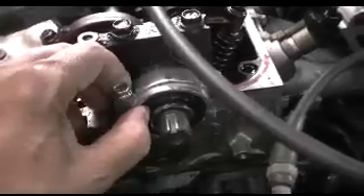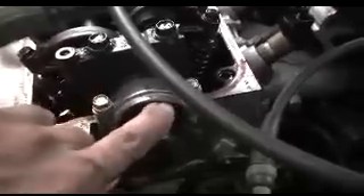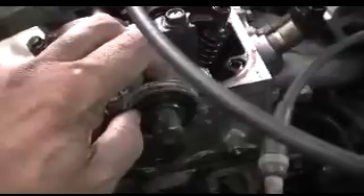At this point I also decided to change the water pump. I pushed the new camshaft seal in by hand — it wasn't as tough as I thought. I used both thumbs on opposite sides and pushed it in, working up and down and left and right. The seal looks seated. I put grease on the outside and inside.